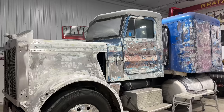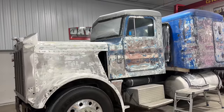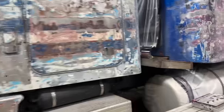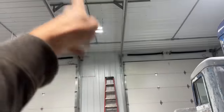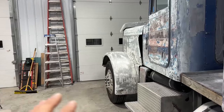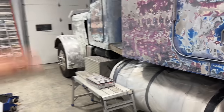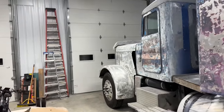I'm just going to do lots of sanding and see how much I can get done on this particular Saturday. Now I would really like to try and get this truck painted before winter. I do have a bit of a challenge with that because the technique I use is I hang a tarp and make kind of what I call a hillbilly paint booth. Then I open up the doors and put a couple drum fans there to try and exhaust all the paint fumes and the overspray out the door. The problem is, as I get closer and closer to winter, it's going to be too cold.